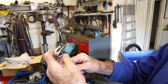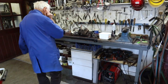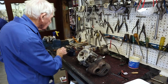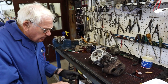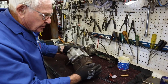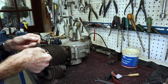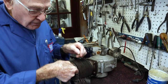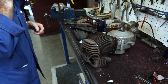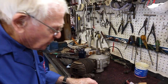Then we'll have a look at the engine over here. We got this far so we'll proceed to pull this apart and let you have a look inside. We'll have the barrel and head off - it's actually one lump. First let me show you how to repair the chipped fins. You cut a template out of cardboard or paper like that, and there's another secret - you get a sticky label and put your template on there.